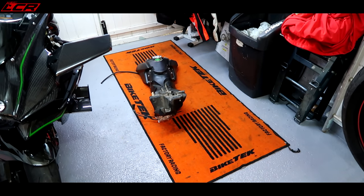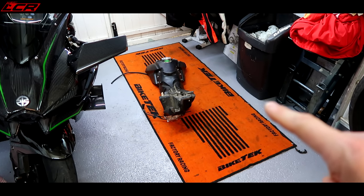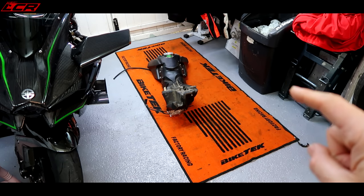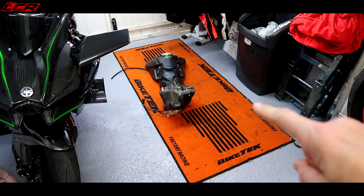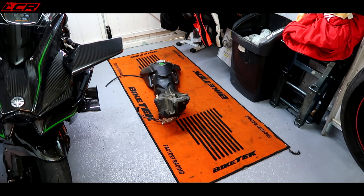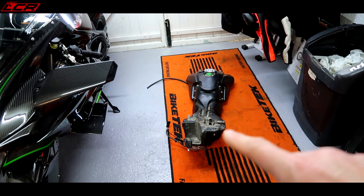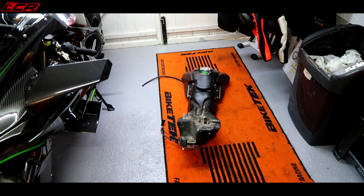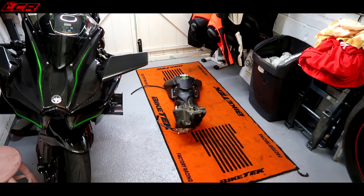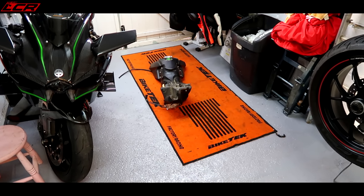As a quick recap, the fuel tank is off and I've now drained the fuel. The fuel pump has an internal fuel filter so I've ordered a new fuel filter - I'll take the pump out of the tank and change that filter, make sure everything's decent, replace any rusty old bolts. A lot of people are saying I should read the manual, which would make things a hell of a lot easier, but I'm a man - I don't read the manual unless I get stuck.